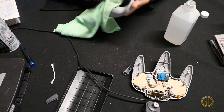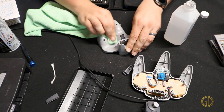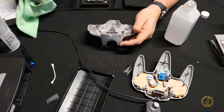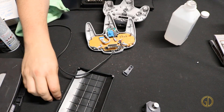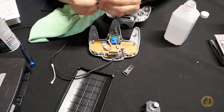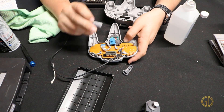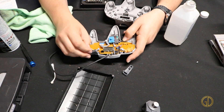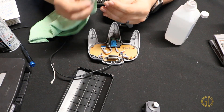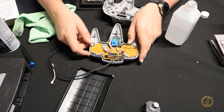While I have it disassembled I'm just going to hit the rest of the outer shell and clean it up as best I can. Now I'm going to put this back together. First things first — I need to put the triggers back in where they go, wipe those down. One thing to keep in mind: this is the top of the controller, so the left trigger goes on your right side when you're looking at it from the top.